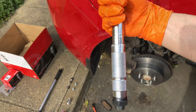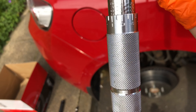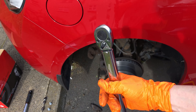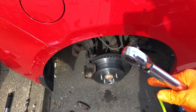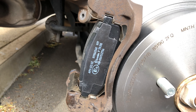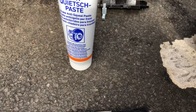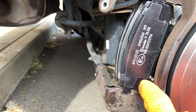I need to be quick before the thread locker hardens. This is my cheap Amazon Basics torque wrench — it feels horrible to use, the torque setting ring just binds and is rough to turn, but I've set it to about 50 foot-pounds. Its advantage is it's shorter for tighter clearance and is already 3/8-inch drive, so I only need one adapter to get to 14mm. The caliper carrier is now installed and torqued up. I've pushed the new Brembo pads in to see where they contact the hardware, so I can apply anti-squeal paste with a pin brush around the ears and the spring contact points — avoiding the friction surface.